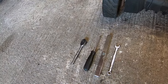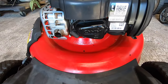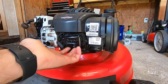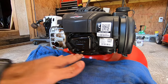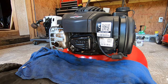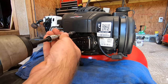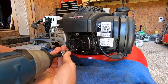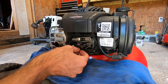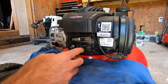I've got a little quarter-inch ratchet - I'll go between the impact or the ratchet - and just a 5/16th socket. We'll go ahead and get the cover off. Let me get a rag to put underneath because when you take this cover off you're gonna get a little bit of oil drip out. I'm gonna go ahead and take the spark plug wire loose for safety. Using the 5/16th to take the valve cover bolts out - and this is what I discovered: the intake valve rocker was basically about to fall off, barely holding on.